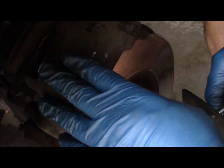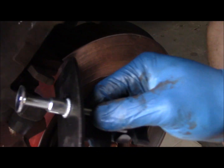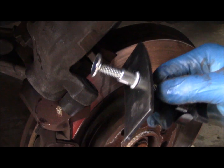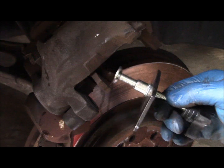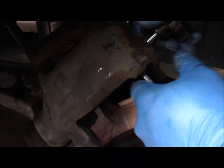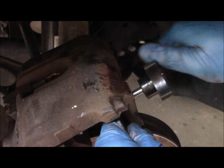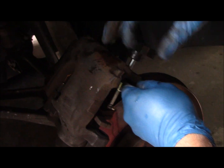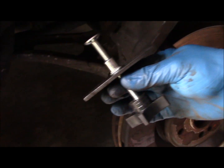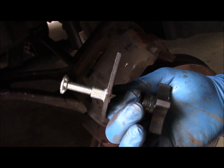The hydraulic portion of the brake caliper apart, we're going to leave the backside pad in that plugs into the hydraulic cylinders, and we're going to use our compressing tool to compress the caliper the rest of the way, because when the new pads go in, they're going to be much thicker than these old pads, so we want the brake caliper to be completely compressed. There, that didn't have far to go. I got this compression tool off of Amazon.com. It was only a couple of bucks, and it's a good investment.